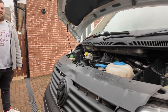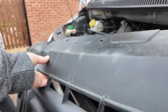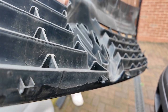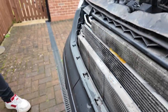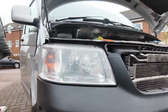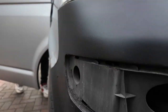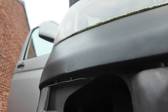We've literally just started with removing the front grille, which was just a couple of plastic turn screws on the top, and then on the bottom there are some little clips. I've just pried these out of the bumper using a flat blade screwdriver — they just come out of there, literally took a couple of seconds. The next step is to take this inner piece out — I used a plastic pry tool. It's just plastic lugs that hold this in place and they just sit on the front edge. There's a bolt in there at the back that we need to get to.